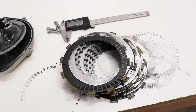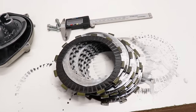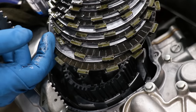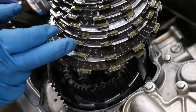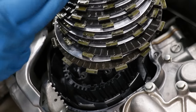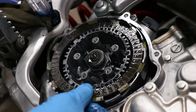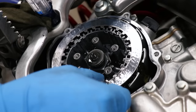Something to keep in mind if you're replacing your clutch plates: you'll need to be soaking them in oil for a day or two prior to installation so the oil has fully penetrated the plates. The order the plates need to go in is a fiber on the bottom followed by a steel, then alternate fiber, steel, fiber, steel — there should be a fiber on top and a fiber on bottom. All these plates will need to go in individually; you can't just set them all in at once like when disassembling.